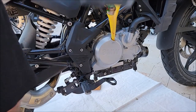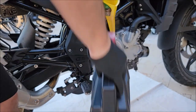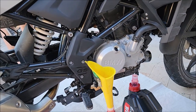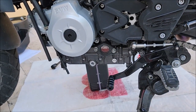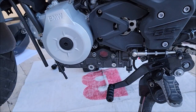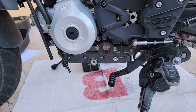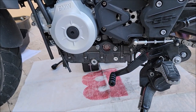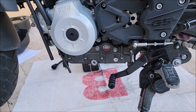When I'm probably at three-quarters of a liter I'm going to start checking the oil level by leveling the bike out, taking it off the kickstand, just to make sure I don't overfill it. Now it's level and you can see the oil. Remember that the oil filter is not yet full of oil — if I had to do it over again I probably would have put oil in the oil filter before screwing it on, which is recommended. I'm just leveling the bike to make sure I have a good oil level, and it does take time for the oil to settle after you start it.